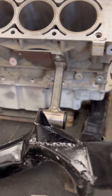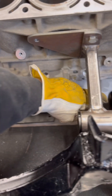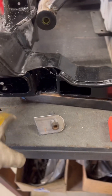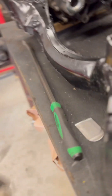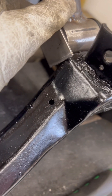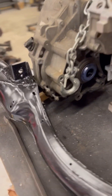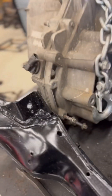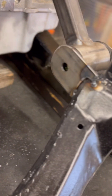This mount is a two-piece mount — this is where your center shaft is going to sit. It's going to weld to this plate. The center shaft goes from here to the axle, and then there's a bracket on here that gets welded there. This one's already cut out — it's going to sit in there like that, rotated and welded. This other side is going to require a little bit more cutting, it's got to be notched out to go around the cradle. I'll get that cut out, tacked on, and then move to the next side, which I think is the hardest side because you've got to get up inside the cradle and there's not a lot of room with a mock-up engine on there.